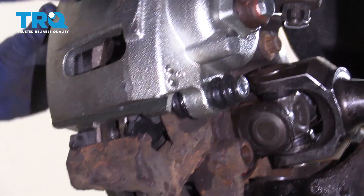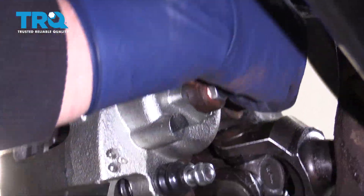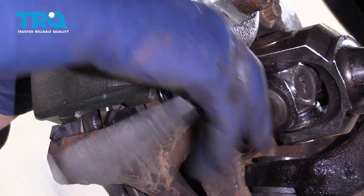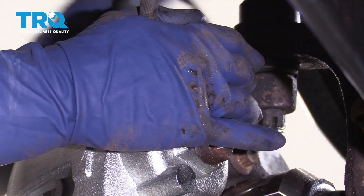Line the brake shoe up on the slider of the bracket — just like that — and the top will slide right down in. Two caliper mounting bolts, which are also the sliding pins. Add them by hand with a 12-millimeter. Snug them up and torque them — the specs are 7 to 15 foot-pounds. I'm going to go right in the middle at 12 foot-pounds.